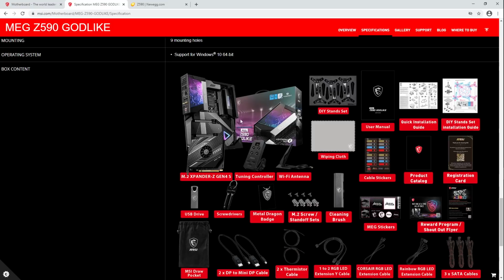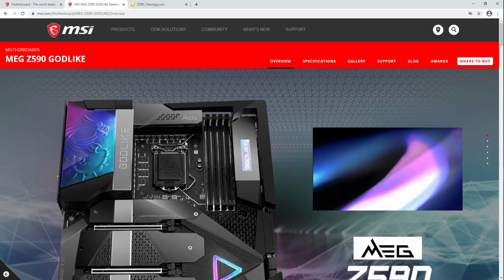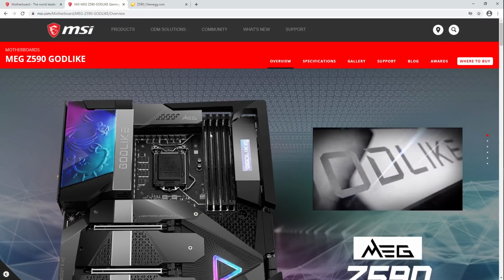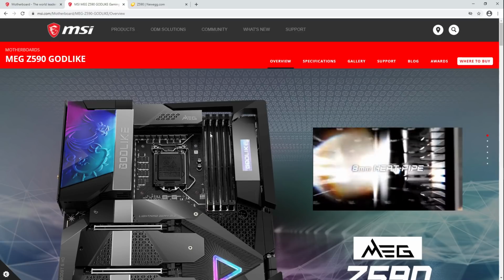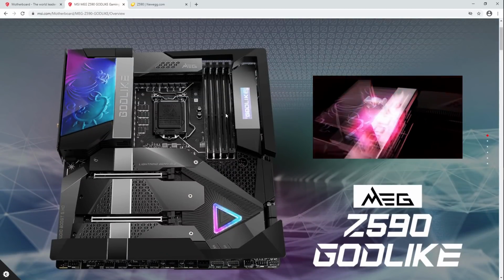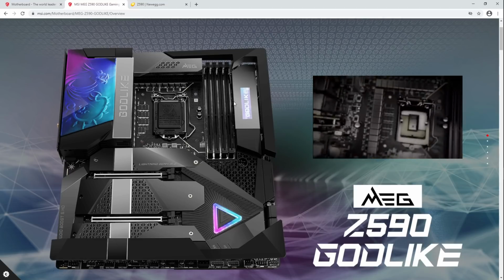This board is just like, no serious overclocker is going to buy this. It's got too many DIMM slots. Though speaking of the DIMM slots, what is neat, MSI is still doing their tabbed traces for the memory topology, and that works really well. That's really flexible. At least on Z490, in my experience, it would work really well in both 2x16 and 4x8 configurations. So from that perspective, it's a really cool flexible memory topology, and I like that about it. It's not too picky about what memory sticks you use, and how many you use. So that's nice. And honestly, even for raw frequency, it does just fine.